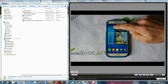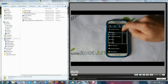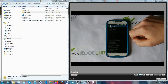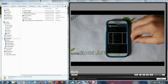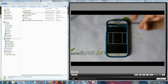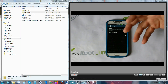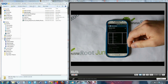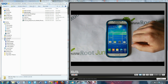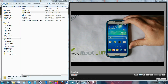I do have a custom ROM and Safe Strap on here, which I'm going to use to demonstrate. If you go into About Phone, here is my build number — it is MK2. So the Odin restore files we're going to flash are MK2 files. You want to flash whatever matches your build number. Before doing any hacking, always know your build number.